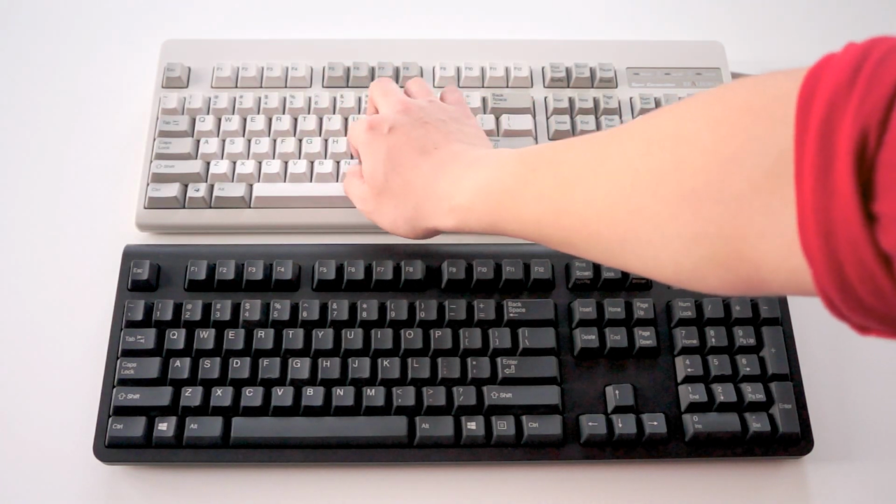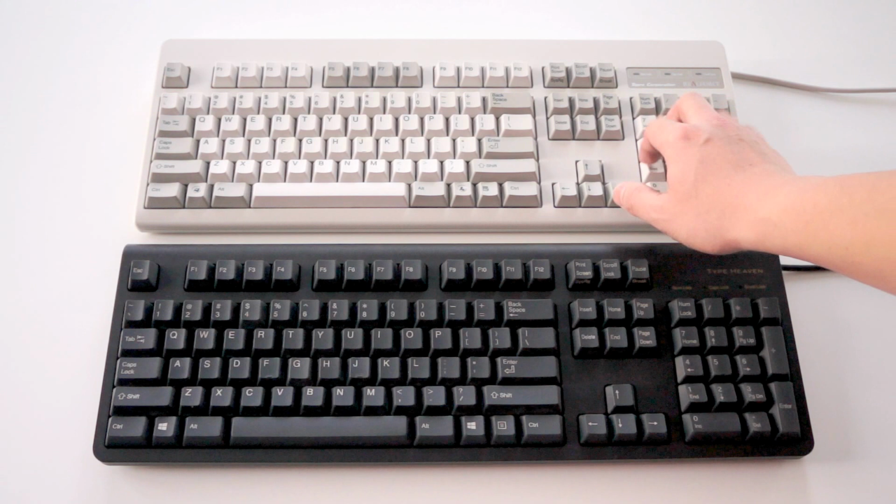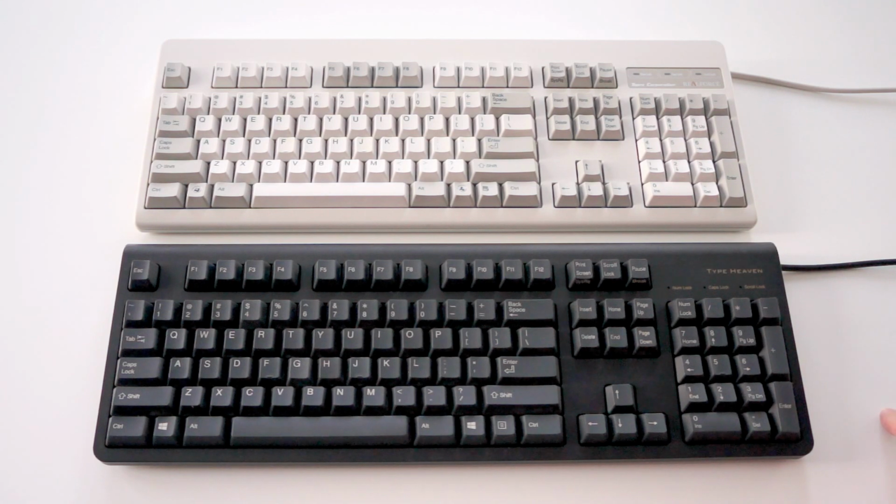Now the question is, is the modded silent as good as the stock silent ring? When you buy the stock Topre silent, by default they cut a little bit of groove into the slider to fit the ring, to offset the travel height. So the stock silent will have less travel reduction compared to the modded silent, because the modded one wasn't meant to be that way. We just do it because it's cheaper. So I would assume stock silent will be a little bit better. It's still reduced a little bit, but it's better than the modded silent. So just keep that in mind.